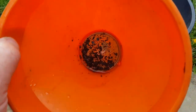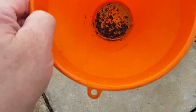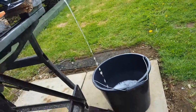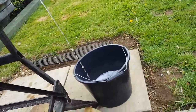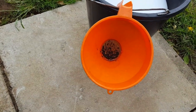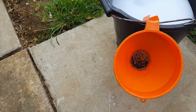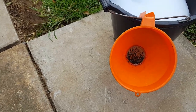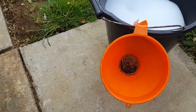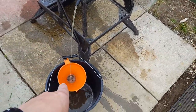That's what came out from just emptying the phosphoric. While I'm sloshing around this water in there, I can actually hear loads of rust in the tank. When I've finished doing this, I'm going to have to take the sump off and wash out all the big bits — try and get all the particles out, then put the sump back on and slosh it again. After that, it's probably going to be WD-40 sprayed in there liberally, and then petrol. I'll filter this water each time I put it through, catching loads of rust.